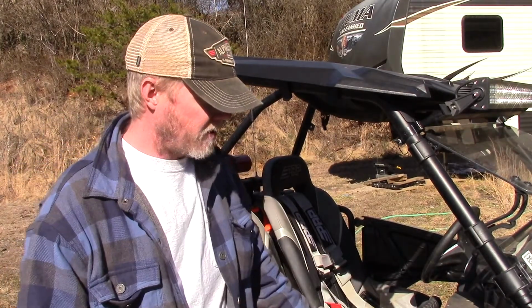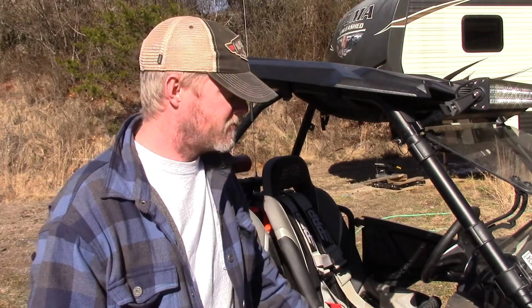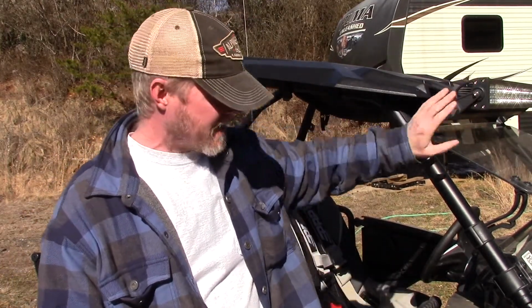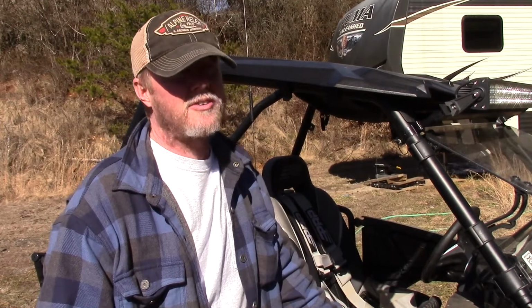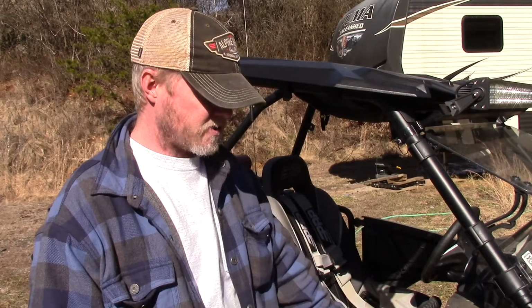If you plan on getting anywhere close to night, make sure that you have lighting. Headlamps is generally what I use, plus I have rock lights and an LED bar. If you're riding at night, headlights generally don't cut it in the mountains. They project directly in front of the machine. They really don't have a lot of broadcast out, and they don't go out that far. Especially if you're traveling at high speed on gravel in the mountains, or you're actually off-road up in some rock garden somewhere, generally those trails aren't straight, so you want as much light as you can get.